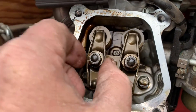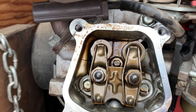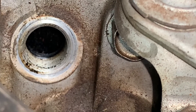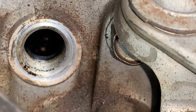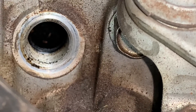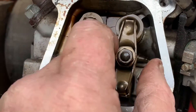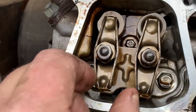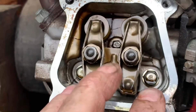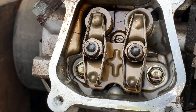However, if you were to adjust these valves with the piston at top dead center on the exhaust stroke, watch what happens. Let's roll the motor over one time. Right here — that should be on the exhaust stroke. As you can tell, we are tight. This may give an inexperienced technician the thought that the valves are just too tight. But if you adjust the valves in this position, the engine is going to run — it just ain't going to run right, because when it comes back around to the compression stroke the valve lash is going to be just too wide.